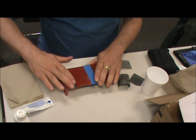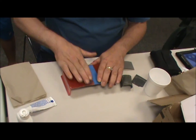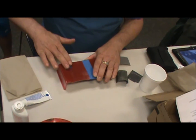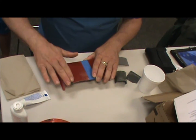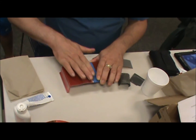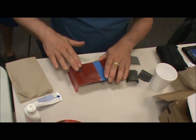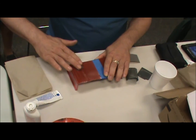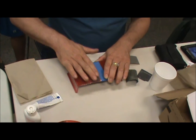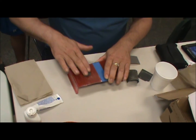I just get the paper wet and spend a few minutes with the 600. This is going to get the biggest bits of the orange peel off. It'll cut fairly fast, so it doesn't really take a lot of time to get the orange peel out. All the other sanding you're going to do is primarily to take care of the sanding marks left by the coarse 600 grit paper.